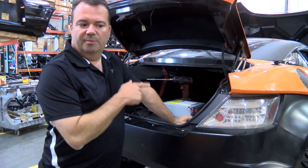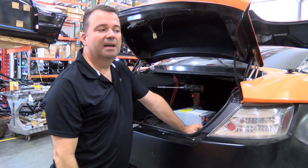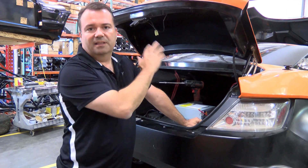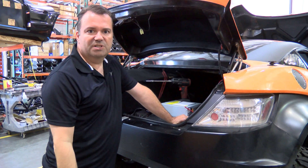The board running in the dashboard and all the support boards are drawing about almost 5 amps when everything's working. When we have the car on the show floor and we're activating the lights and all these different systems, we're potentially drawing 25 or 30 amps or so. Over the course of a day at the show, that's going to run the battery down.